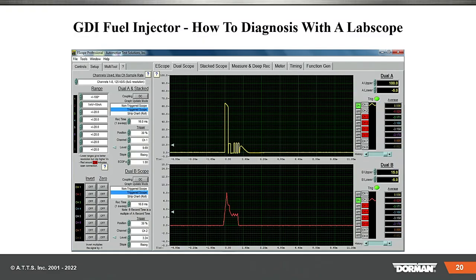Always depressurize the fuel system by removing the fuel pump relay or disconnecting the fuel pump and crank the engine over until the fuel pressure is drawn down to a safe level. The pressure can be monitored using the data PIDs. When installing a new high pressure pump, make sure it is positioned correctly with the cam and slowly tighten it. You do not want to be on the high lobe of the cam.